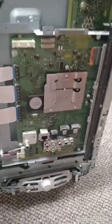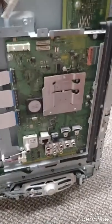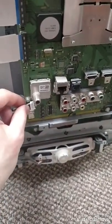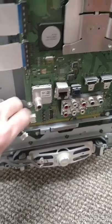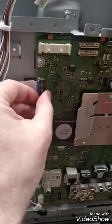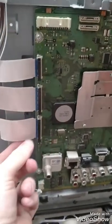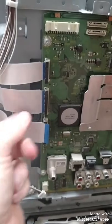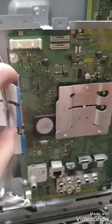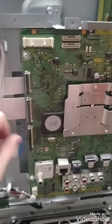It's pretty simple — just pull it out. Down here you have a little piece, you just shimmy this one out and this one as well — it shimmies right on out. That frees up this area. Then you have these ribbon cables — all you do is lift up the little tabs and shimmy them out, being very careful not to rip or tear them. You can push them out of the way or tuck them under if you want.